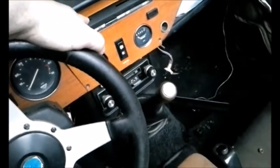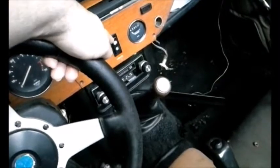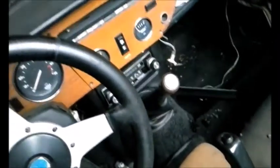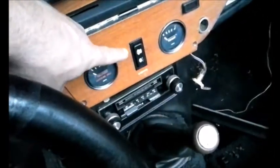The other thing I did was, as far as the electrical for the car goes, it has no running lights. You can hit the switch there and get headlights, but no running lights. So I figured maybe it's just in the switch, so I replaced the headlight switch with a brand new one. Guess what? Same problem — still have no running lights.